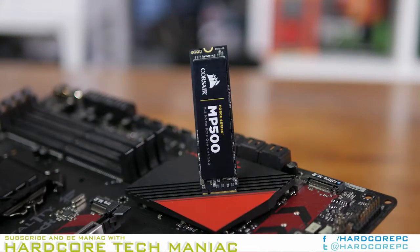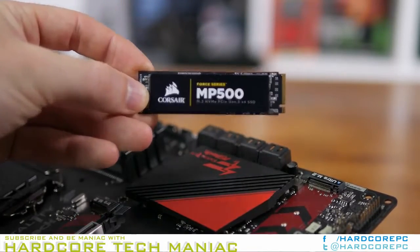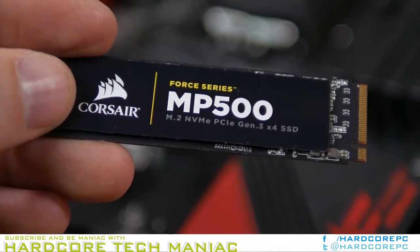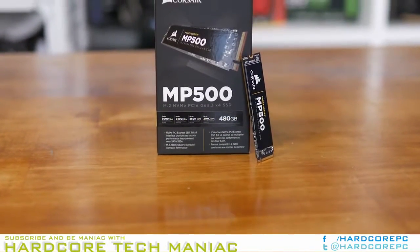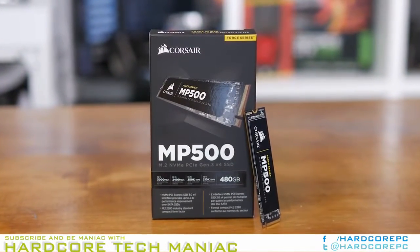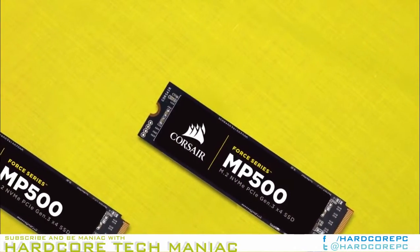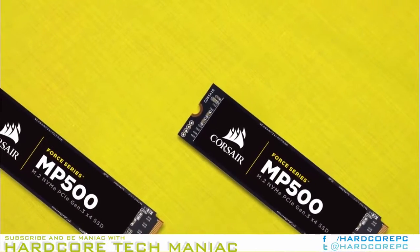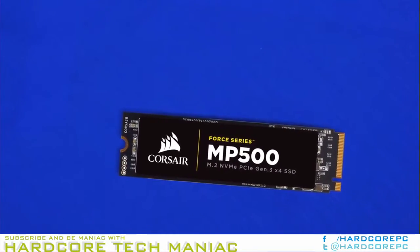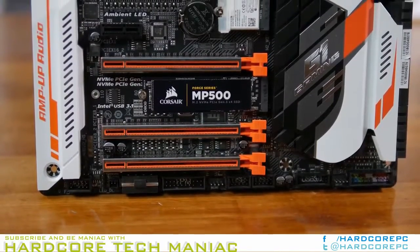The overall layout of components appears the same as the other E7 SSDs we've tested in the M.2 form factor. Every capacity uses a double-sided version of the 2280 form factor. This may cause installation issues in some early M.2 enabled notebooks, but all modern designs seem to work fine with the extra thickness. There are at least 4-5 layers to the controller-side sticker. The copper layer rests just one layer away from the controller, DRAM and flash packages.